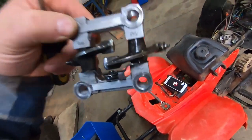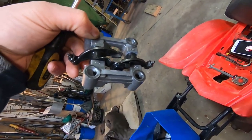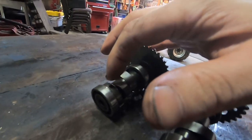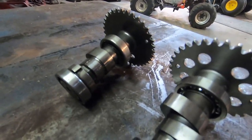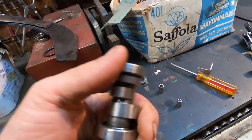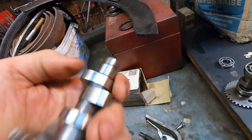That slides right off and E is labeled for exhaust. This is oriented like so, and all you do is wiggle the chain and pull it off. The one thing I see is there's a little notch here and I may need to pull that whole deal off and press it onto this one — so that sucks. I'm going to take this little piece off of this and put it on this shaft so that they're the same.